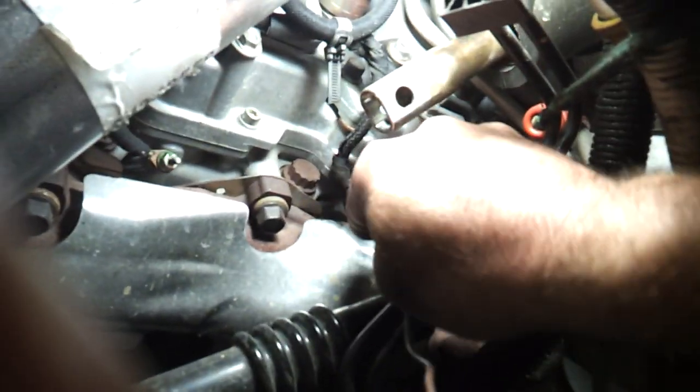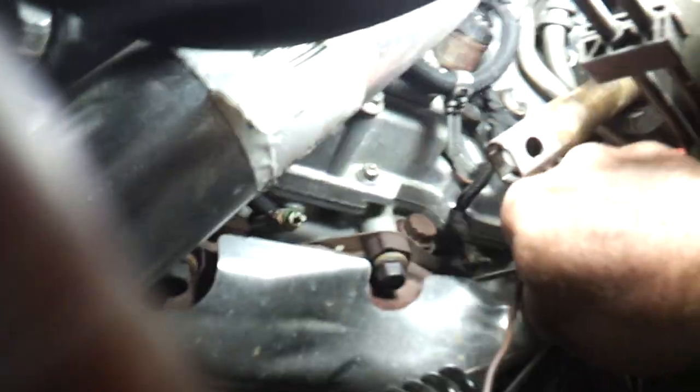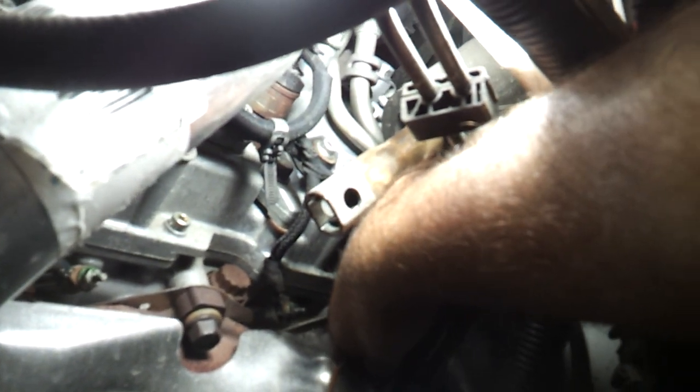That's me touching number 6. I'm going to get back here and check number 8 — glow plug lights. Checking number 4 — no light. I have a P0674 stored, so that would make sense.